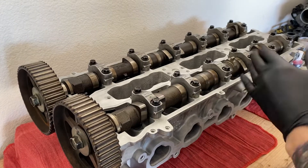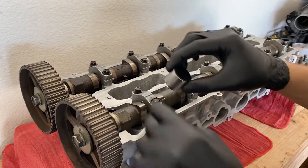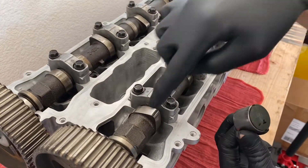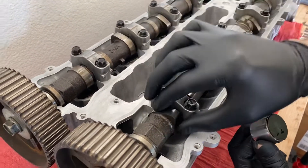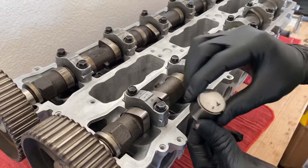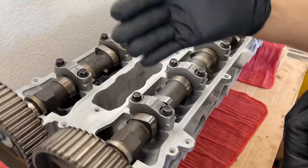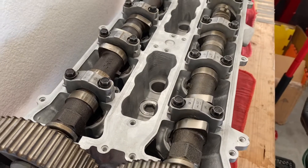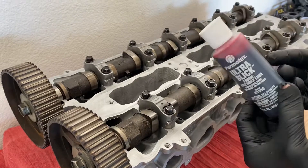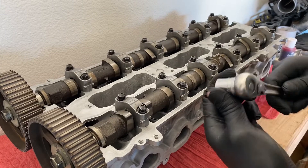These sit inside the head under the cam lobes at almost a 30-degree angle. When you're checking your valve lash, make sure the cam lobes — this pointed part — are facing up but at the same angle as these buckets, almost at a 30-degree angle. You want the bottom of that lobe to be parallel with the top of the shim. Don't forget to use your lube — lube up all the journals. I also have my 17mm socket and wrench to turn the cam gears when needed.